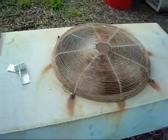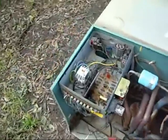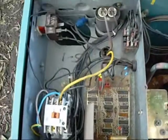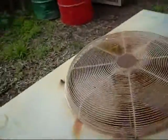The fan still works — that's a good sign. Not much else though. Big capacitor hanging down the bottom there. Very slow to start up; the fan takes a long time to get going. The cap's half bugged.